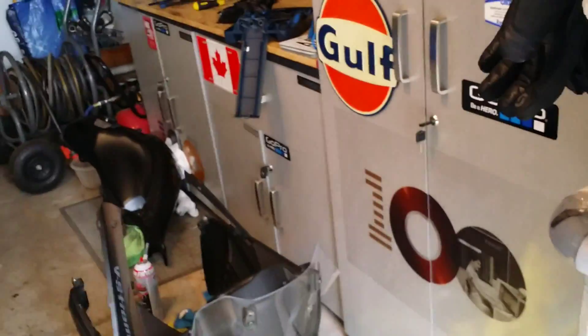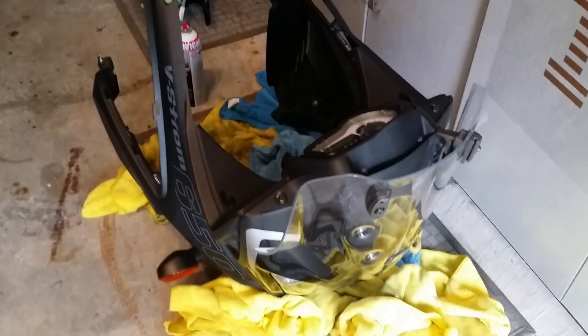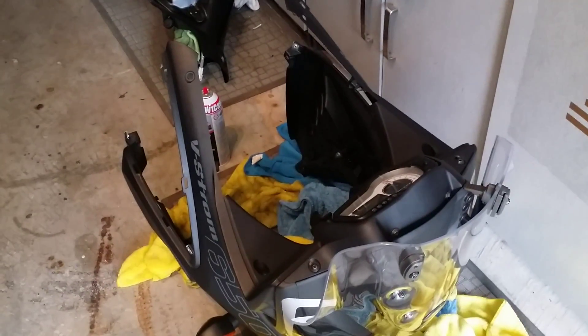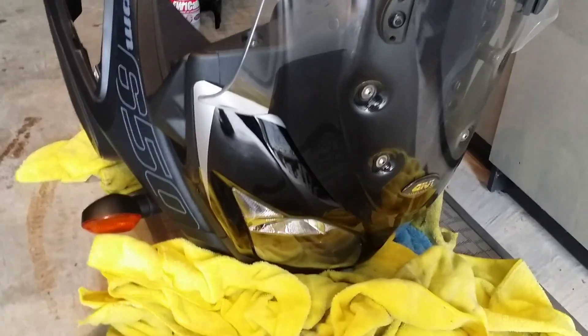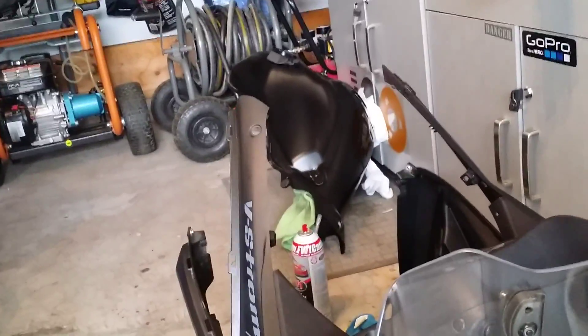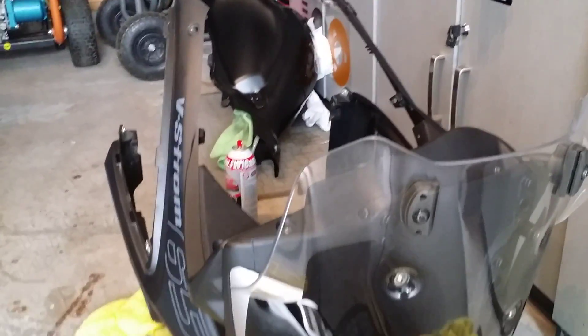Before I put this thing on, I just want to point out how it looks when you take it off, so that's a reference. As you can see, the part that goes around the tank is all connected — the entire unit is connected. The front fairing and a bit of the side are connected, so you can see what bolts you have to take off. There are two on the side and then two on the frame. Pretty simple, but I just wanted this as a reference so you can see what it looks like — this whole part just comes right off.